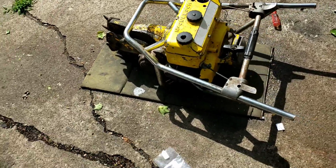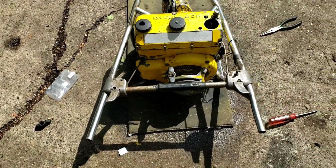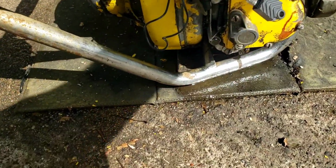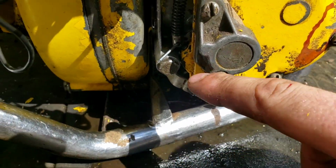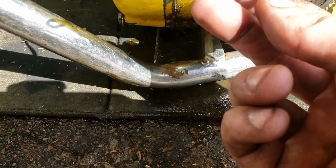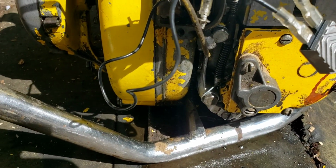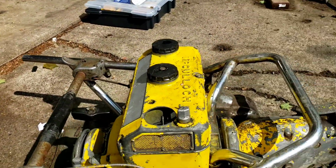The high idle thing I'm unsure of, but I'm thinking that the butterfly blade is not allowed to close all the way, because when I turn the idle down, the fuel off, it's not able. I know it's a nail, but it's not stopping anything. It's not able to go down as far as the screw here, so I'll look further into that. Because adjusting the mixture there, it just slowly dies and fades off.